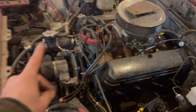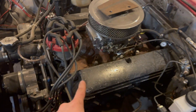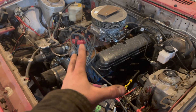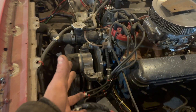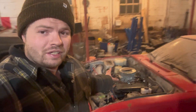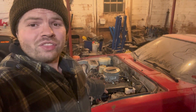This engine was done very well — the short block was a known runner, didn't leak. The only things we changed on this engine were the oil pan for clearance, the Holley carburetor because it didn't have one, the air cleaner, and the water pump — we elected to go with an electric water pump. The rear main seal was leaking so we changed that, but that's pretty much it. The rest is a factory '85 or '87 HO Mustang engine.